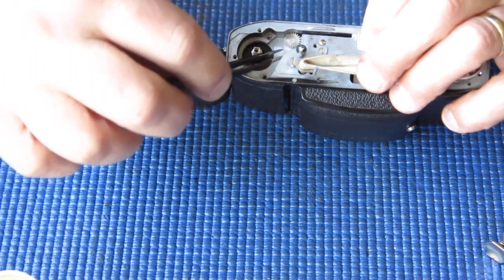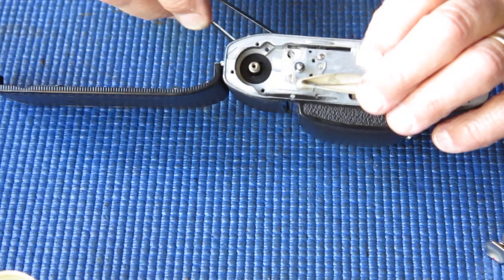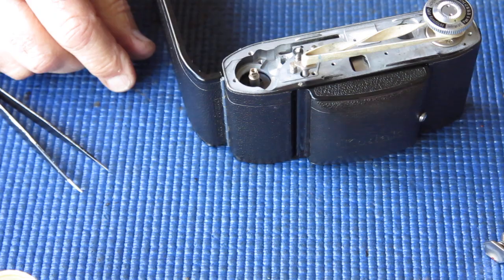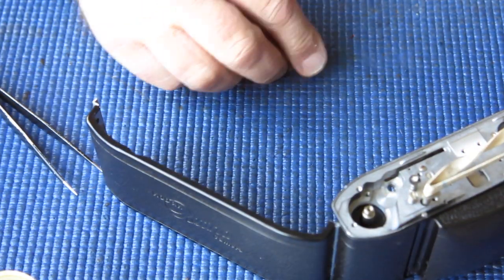At the base of the camera, I'm holding some pressure on that shaft from the top with my finger. At the base of the camera I'm pulling back the lock lever so that it can pass all the way through. Let's close the front of the camera up — oh, I shouldn't do that yet. I need to do this top piece first. I'm forgetting myself — on the Retina 2A you could get away with that, but on the 3C you do things in the right order or you won't get the parts together.